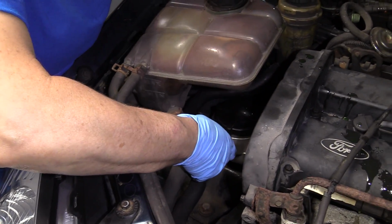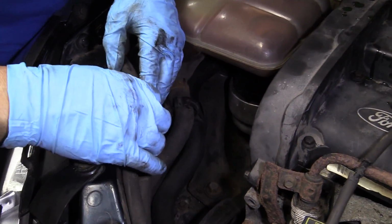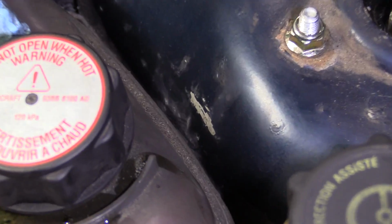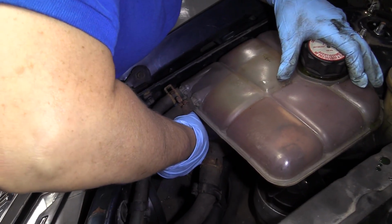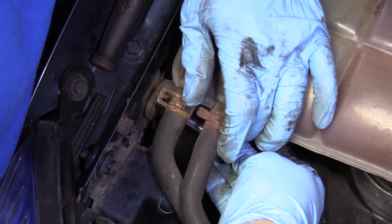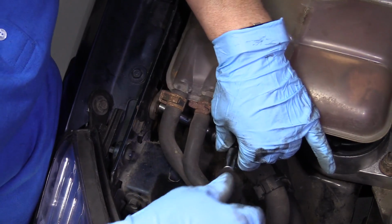repositioned. So you've got these plastic clips that hold the actual lines together. Get that clicked in, and now there is a plastic line-up tool on this side, right on the strut tower. That's going to go there, and it lines up that ear for the 1 bolt left. It's a little sheet metal bolt, or screw, sorry. So I just put the bolt on an extension. It is a 10mm socket. There you go. Just going to snug it down. I don't worry about torquing anything like this.